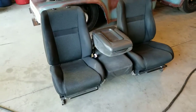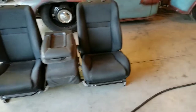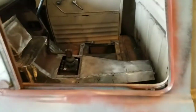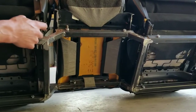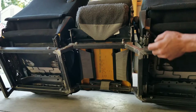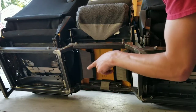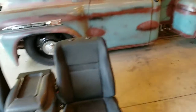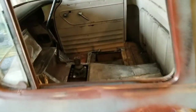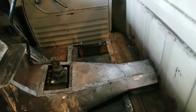I had originally had them installed a few weeks ago individually in three different pieces, but due to the seat placement inside the cab, it was a little difficult to get them all centered up, so I went ahead and built a seat frame out of one-inch square tubing, eighth wall. I have each seat mounted to the frame with four bolts in three individual pieces, so I can take the center console and the two seats off the frame, put the frame in, and then mount the seats to the frame. The seat frame will need to tilt up so I can get to the battery box, which is underneath the passenger seat.